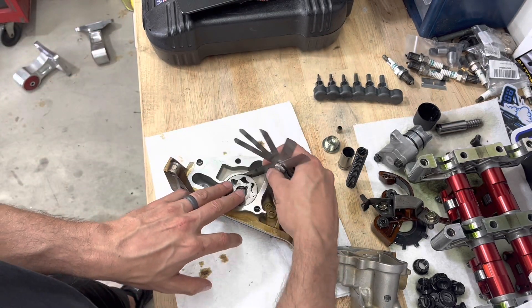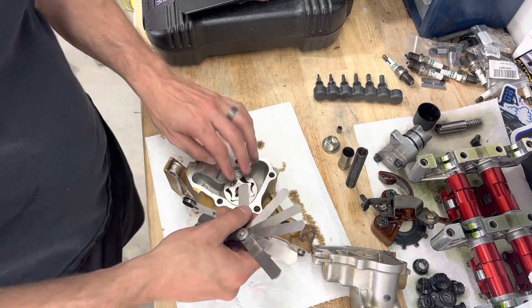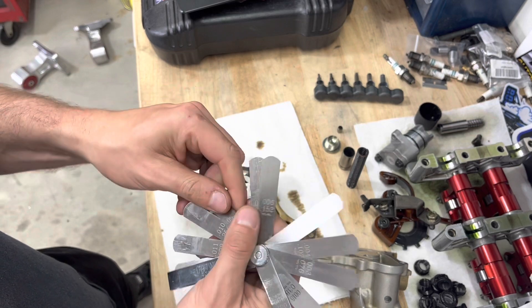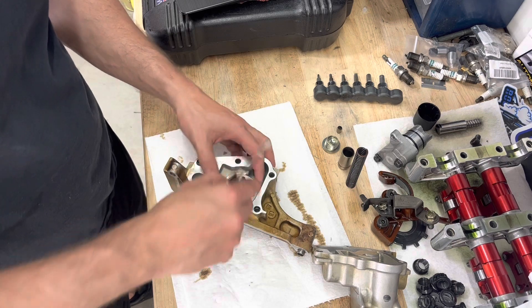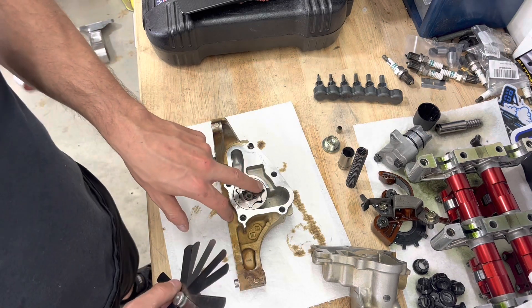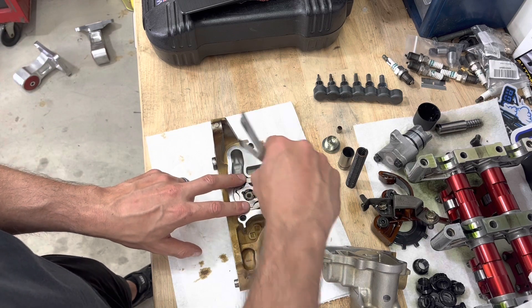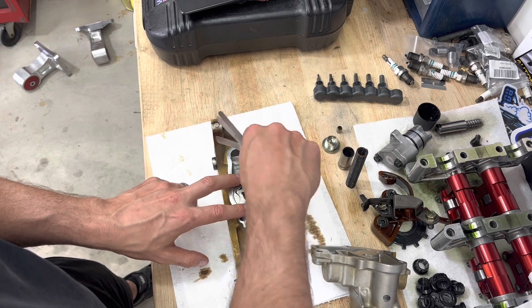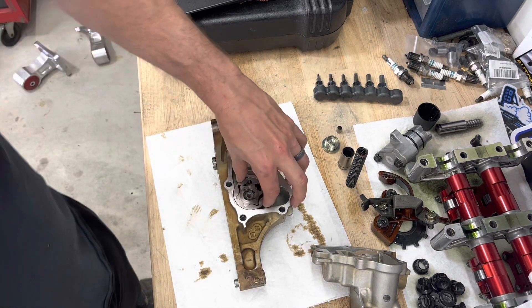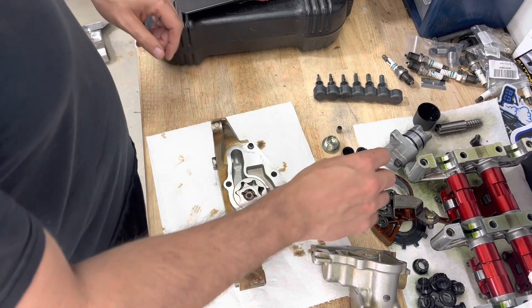Six kind of fits but it's pretty tight. A new one is six to eight thousandths and nine thousandths is your service limit — if you have nine thousandths clearance, that's a bad pump, and the nine gauge is not going in at all. There's also a limit from the inside portion: service limit is eight thousandths, new limit is one to six thousandths. I was able to get a four in there but not a five, so I got a four — right in new limits. This pump is in very good shape; I won't have any problems running it.